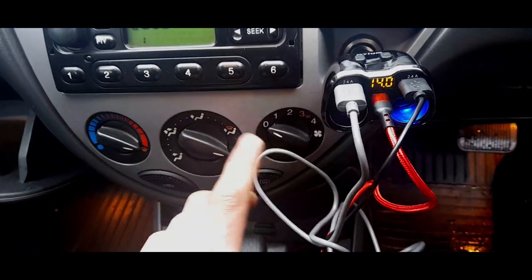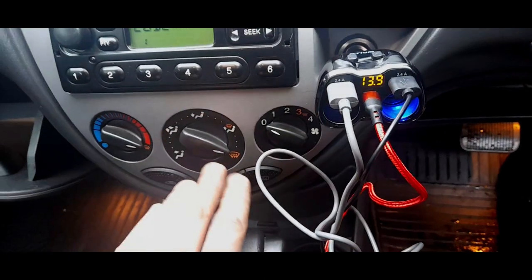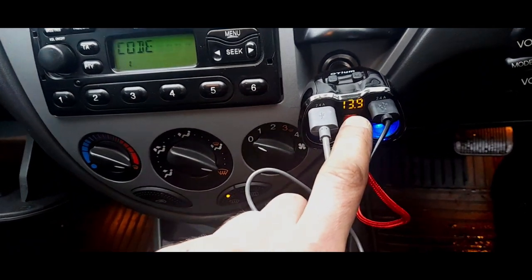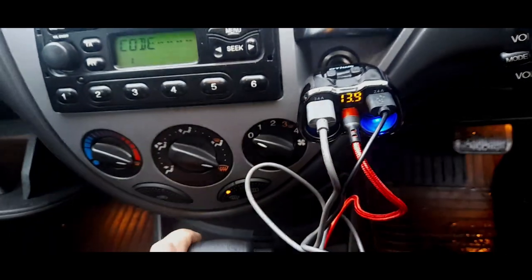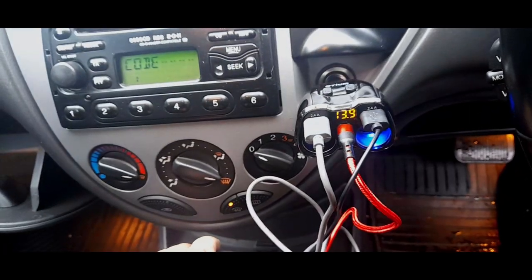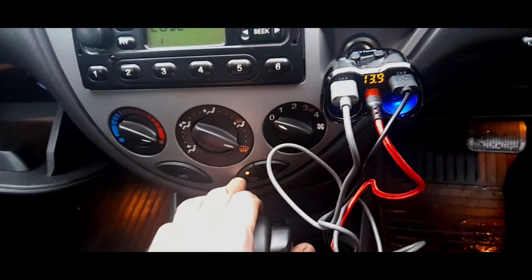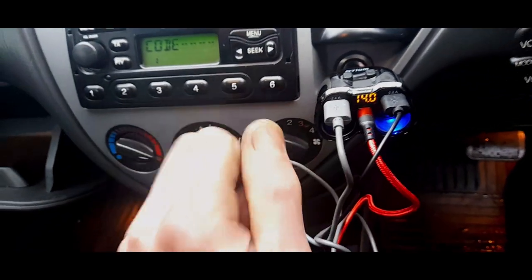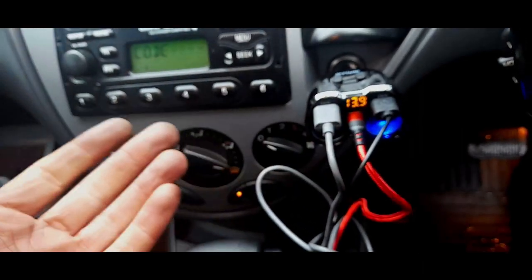Usually it dropped to 12. If it drops below 12 volts, I've had that before. Now, I had that with the old belt. Now, clearly this belt is better because the old belt, you press that button and it would go to 12 volts. So you could tell that that belt was just not tensioned properly. It's a good belt to have as an emergency backup, but the Ford belt clearly is doing its thing, and that's what will happen with a Ford belt. It tensions and the alternator is producing the right voltage because there's no slipping.